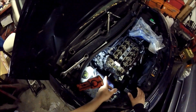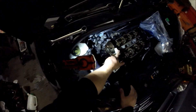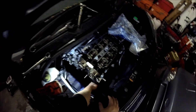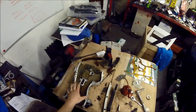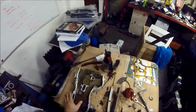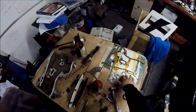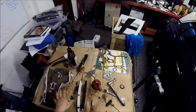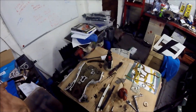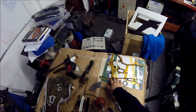I've already cleaned everything. I've got the hydraulic tensioner already mounted to the back, got a new top runner on, and everything is clean and free of oil. All surfaces are ready to take the new gasket. I've also laid everything out here — got the timing chain cover all clean, free of all old gasket material, new gasket, bottom tensioner runner, new guide runners — that's the back one and this is the front one. All the bolts and tools are laid out. We are literally ready to go.